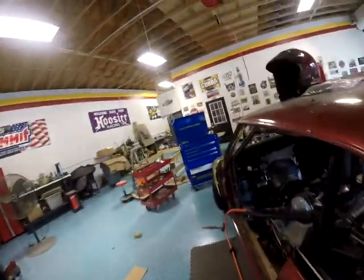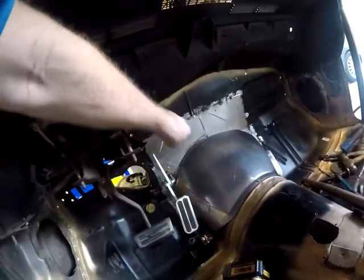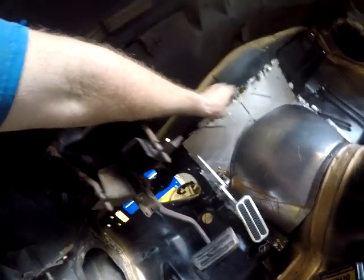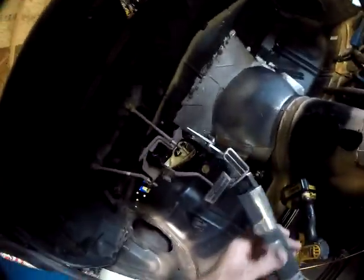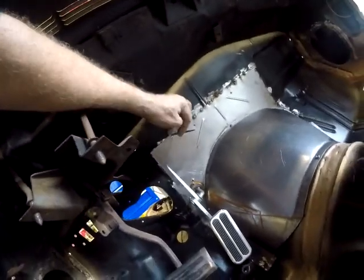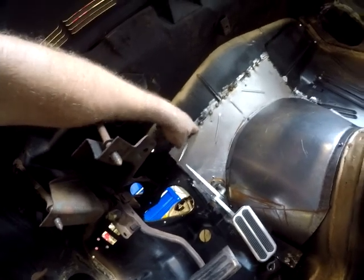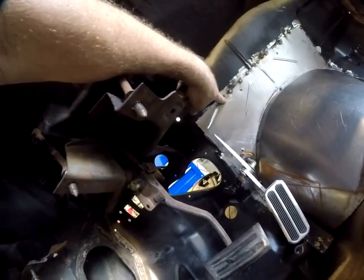Okay. Hey, back working on that Chevelle, you know? Where we left off is I have my pedal mounted where I want it. Have the tunnel put in, and right now I'm cutting and tack welding the piece of sheet metal in there. So what I do is take this handy dandy little saw right here, cut along just inside the metal, and then that gives me a nice little tiny gap to weld most of the time. Doesn't always work out because I kind of messed up and went off. But anyhow, got back on track and here's what I'm dealing with.